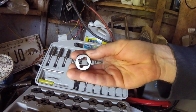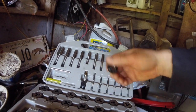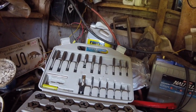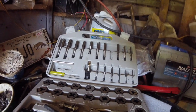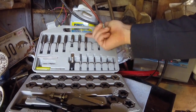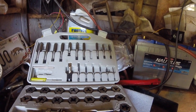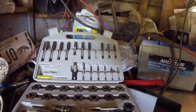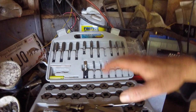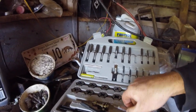That's the tap. The die is pretty much the same idea — you put your rod of metal into the die and it will cut threads onto it to make a bolt. Three steps to using it. If you stripped a hole, you can go to the next larger size and tap your own threads — you've saved a pile of money. For twenty dollars this saved probably fifty in parts, and another fifty in labor if I'd sent it away. This kit paid for itself in one use.